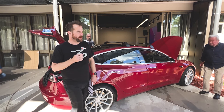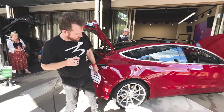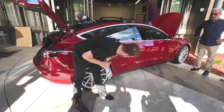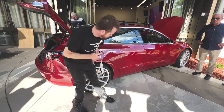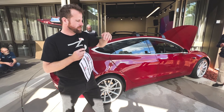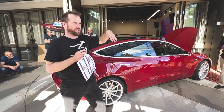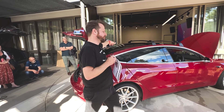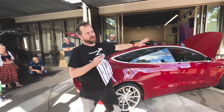You should also check tyre tread and know how tread indicators work. If you feel around the tyre in one of the grooves that run around the outside, you'll feel a little line in the bottom of those grooves occasionally — there are about six of them around the tyre. If those little lines across the face of the tyre are close to the surface, the tyre's worn out. Check all of them right across the face, particularly the inside one — you'll need to reach in and feel it. If any of them are at the surface, the tyre's worn out and you need a new one.